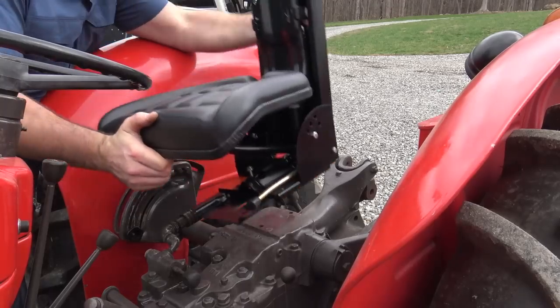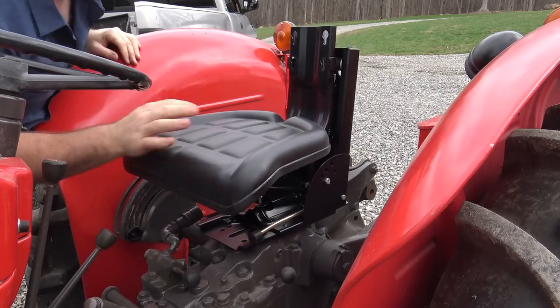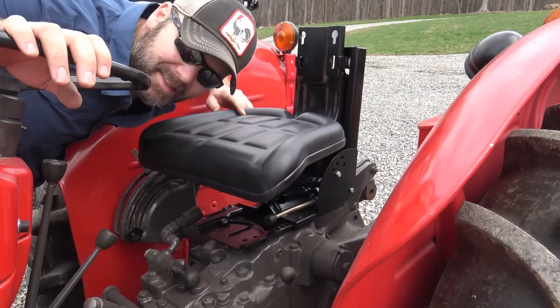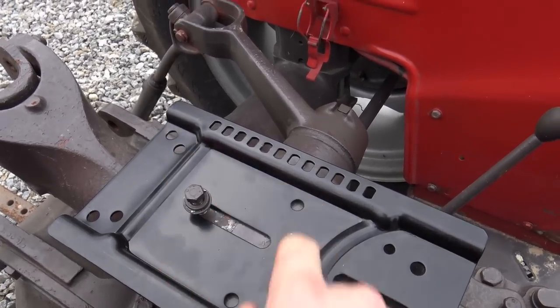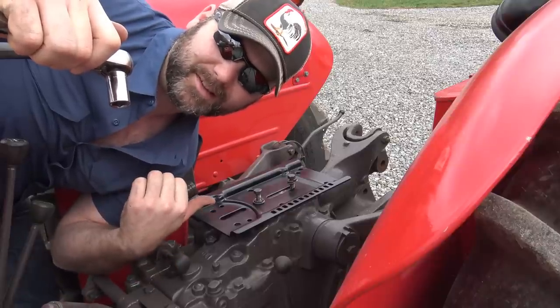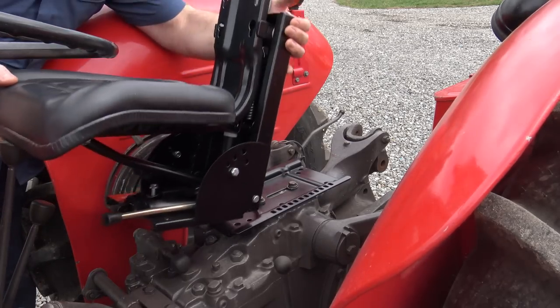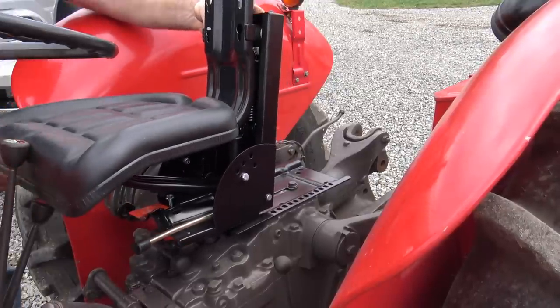My mind tells me to put the seat right in the middle of where it should be, set it on here, and see what it looks like — will it jam my knees into the front of the tractor? It probably needs to be up about two more inches. Let's mock it up: there's where she'll sit. It's going to sit okay but the bolts don't line up with the holes. That looks pretty good — I think we'll try it. Hot dog, it works! Let's tighten these bolts up.